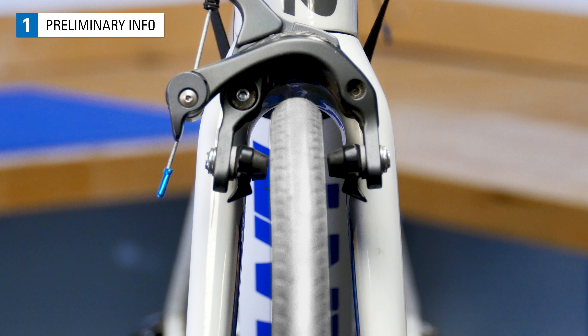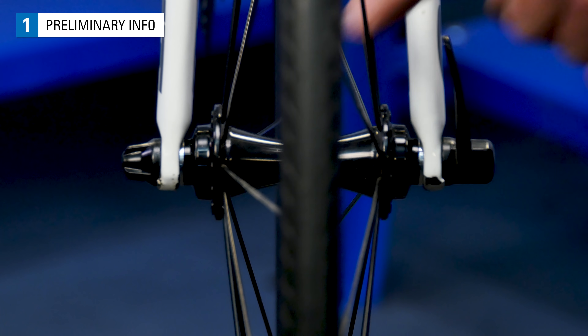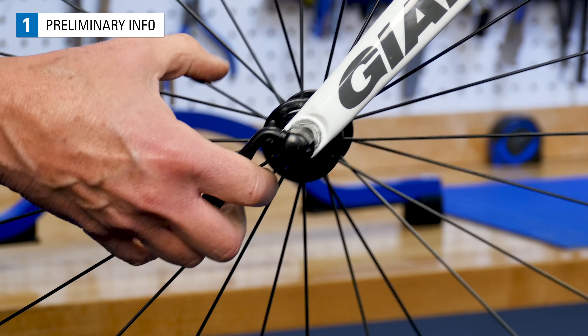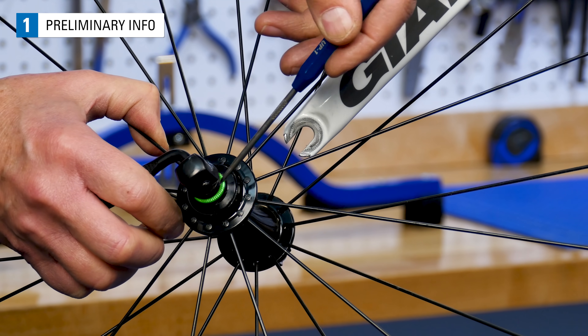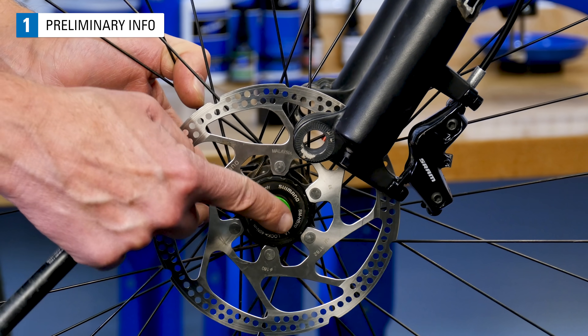The wheel and rim of the bicycle should be centered to the middle of the frame or fork, which also places the rim over the middle of the hub. For bikes using open dropouts, the rim is centered between the hub lock nut faces, which are the contact points for the frame or fork. For through axle wheels, the face of the hub caps are the contact points for centering the rim.